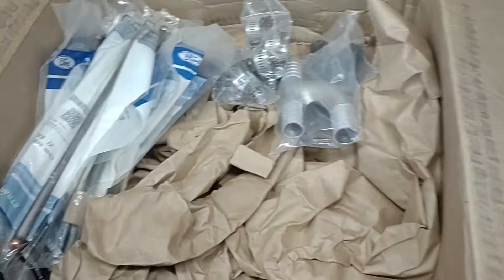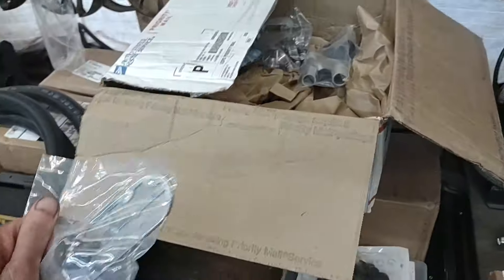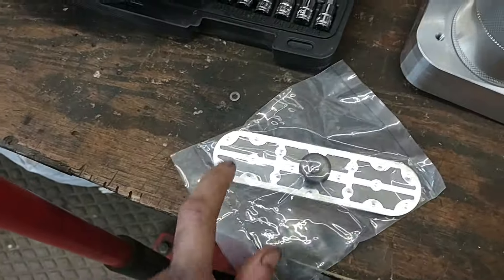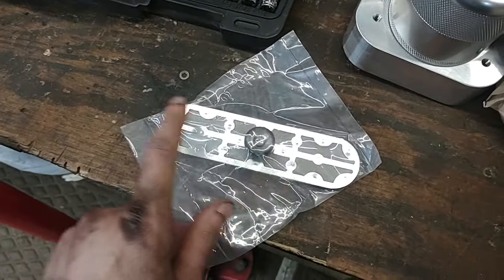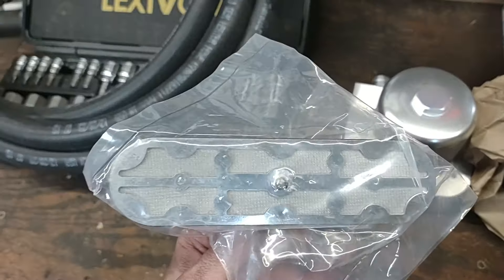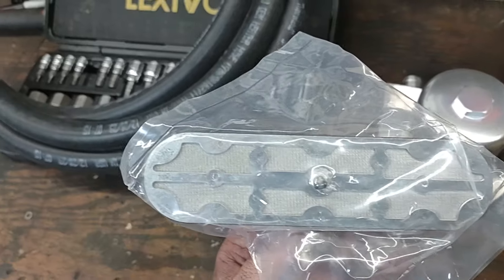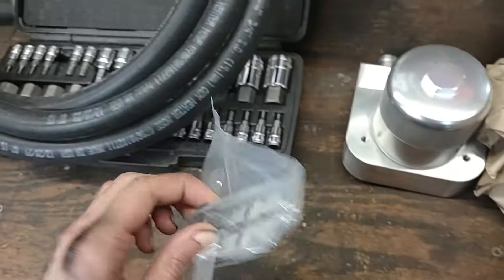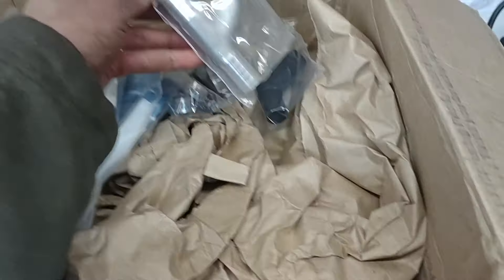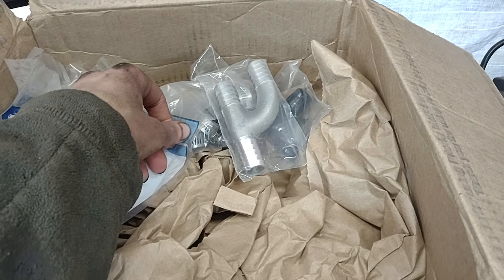So I got that. Under your oil cooler you have the typical screen, but it's plastic — plastic with like a nylon mesh. IPR came up with this: it's all stainless steel and aluminum with a stainless steel slash aluminum screen. So I no longer have to ever worry about that screen being ripped, torn, or blown out. The rest of the accessories go with that system too.